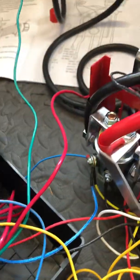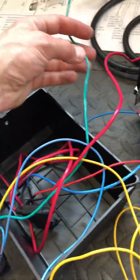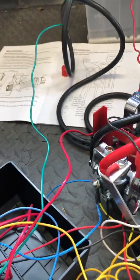From there it's quite simple — you just need to wire up your Carling switch. The top pin, which is pin seven, goes to ground. When doing this in your car, you could simply earth it to the body; you don't need to send it all the way back to the battery. I did so because I knew I'd get a clean connection on this rig.